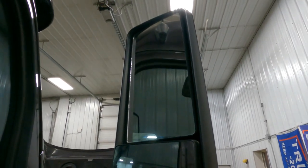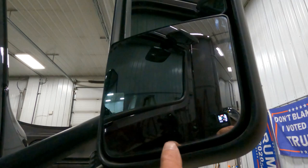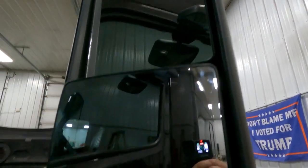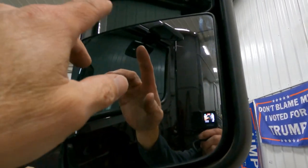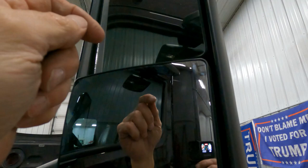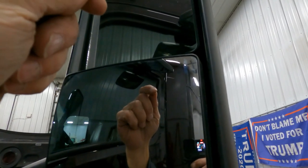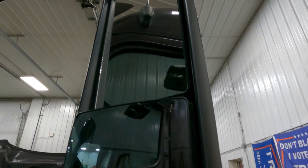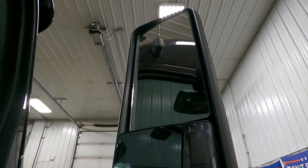I didn't video it, but YouTube, here's how to tear these mirrors apart — it's pretty simple. Just pop the bottom mirror, run the mirror all the way in on the bottom, this bottom one pops up, and then you let that hang down. Stick your hand in behind the mirror right above the wires for the electric heat, push a tab in, push it up a little bit, then run the mirror motor out and the mirror just pops right out of there. So any questions, YouTube?